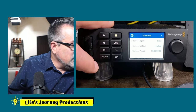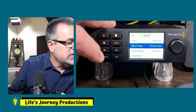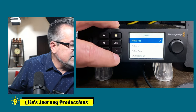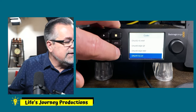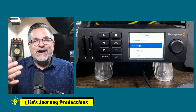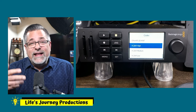You can also set it to automatically start and stop. In this menu you can choose your codec — click to this page, hit Set, use the arrow keys, and scroll down to choose any of these codecs, all the way down to H.264. If you record in H.264 you have low, medium, and high settings.